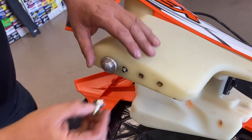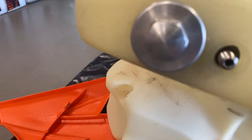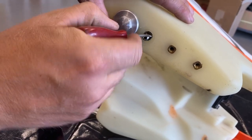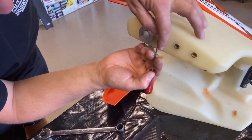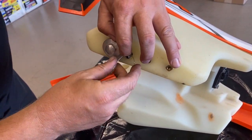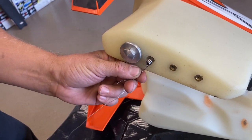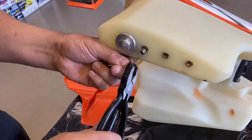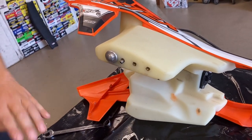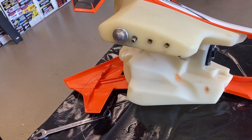One of the big tough things on this is getting the wire run back through the tank. We have a 19 on this fitting here — we're going to loosen that. You can see the O-ring inside there way in there, and we want to make sure that doesn't get damaged. So with that O-ring out of the way, we can get our wire on there. This will save you a little time — you don't have to do this step this way; I have a video showing how to feed the wire through. But if you do it right now, you don't have to feed the wire through the tank, which is kind of nice. This way when we pull the pump out, we can run the wire all the way through the tank and we don't have to do it twice. Now we can pull off the nut — it holds the fuel pump in place. Our guy here likes to tie a wrench to it so you don't accidentally pull the wire all the way through the tank and have to do it again.